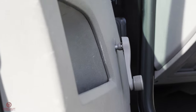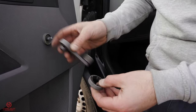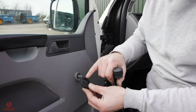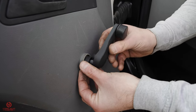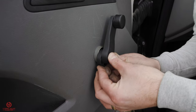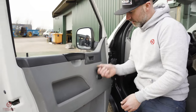Those of you with a T4 or T5 with winder handles know they can break. The part that breaks is the little locking ring that keeps your handles on the vent. To replace it, put the locking ring on making sure the tab is in the position you want the handle, because the nibble sits in that part of the handle. Push it in, put the handle on, line up the two positions, then push the locking ring up. It took a little bit of fiddling, but now there's a new handle.